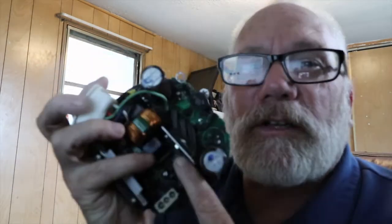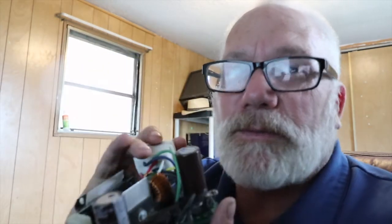I did and found out the thermistor was bad - it's reading 1.9 to 2 ohms. Two ohms means it's probably not working properly. But there's no use in me replacing it now because when I pulled all the stuff out of here looking for a screw, I ruined the board. So I bought a used one for a hundred bucks.